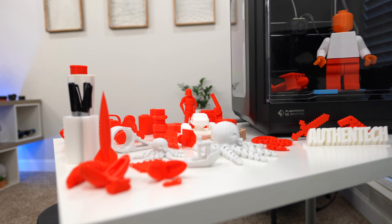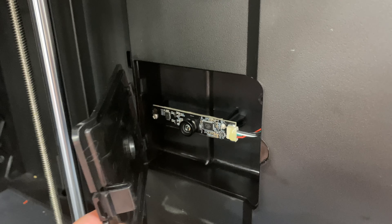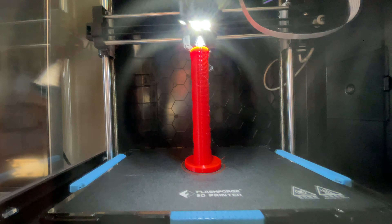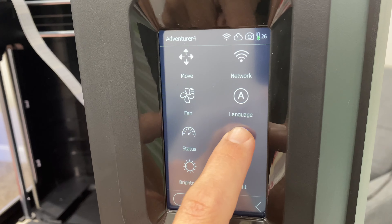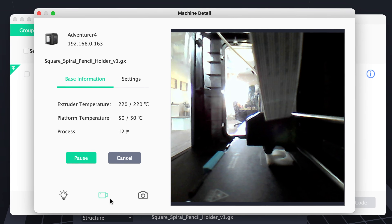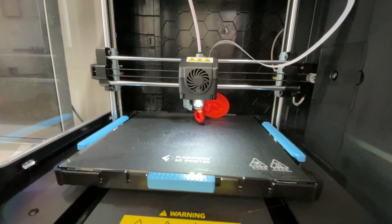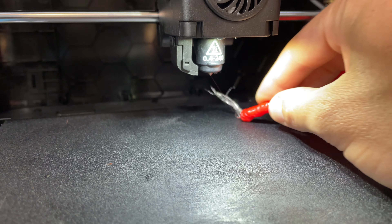My third favorite feature is the HD camera built in for monitoring and watching prints remotely. There are dual LEDs to light up the platform, so I can start a print and watch it from almost anywhere, day or night. This is really nice for capturing photos and even time lapses built right into the machine — though I personally couldn't get the time-lapse feature to work for me. I also like having the camera to make sure prints are on track, and if something goes off the rails I can pause it remotely, possibly saving a ton of wasted filament. A lot of people add cameras and use Raspberry Pi and OctoPrint to enable these features — I really like that they're built right in with no mods needed.